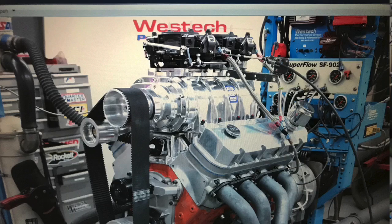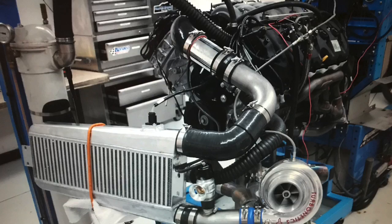That's why we run ring gap. That's why the factory ring has ring gap, and that's why we increase it when we run boost — because we're trying to give room for the piston ring to grow and not touch. You do not want those rings biting together and snapping the piston. We've all seen that — LS guys, big block Chevy guys, small block Chevy guys, modular Ford — we've all done it, because we've run lots of motors.